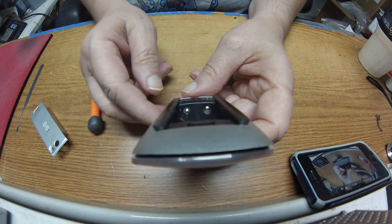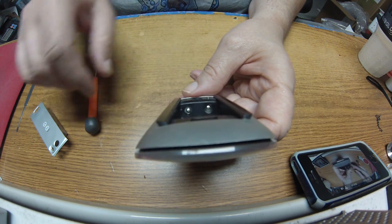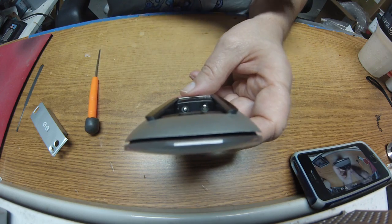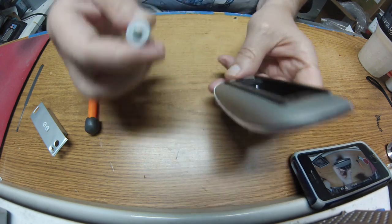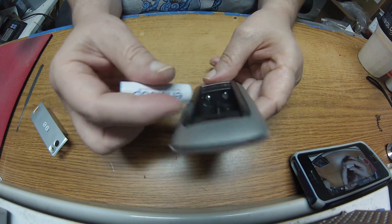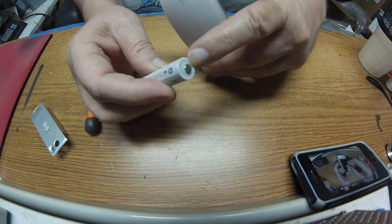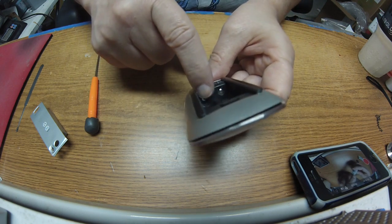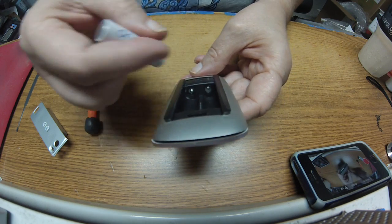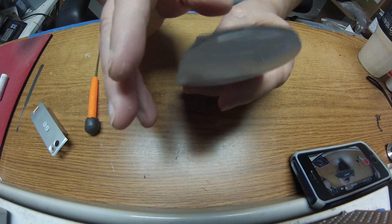That works but it's not a great solution. Your average battery — this tip is sometimes not quite long enough to stick inside that hole. What happens is this edge that's insulated rubs up against the plastic here, and the tip won't go in the hole. So that's fix number one — that fixes the mouse to start with.